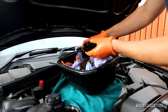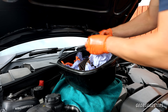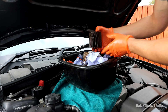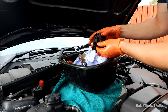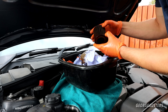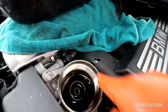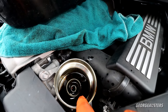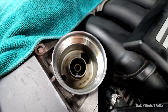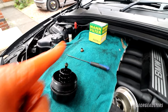You need to keep that cage — it's very, very vital to have it in place or you'll lose oil pressure. Put that back in the cap. The filter still looks to be in one piece, very hot though. Can't see any major chunks in it, which is always a good thing. I just like to wipe out any of the old oil inside of the oil filter housing and give that a little bit of a clean out.